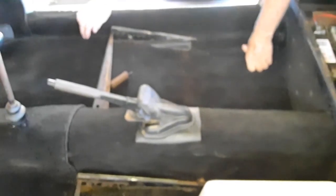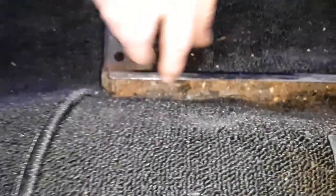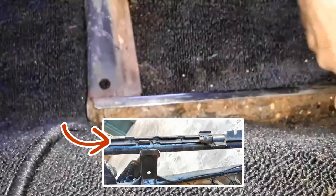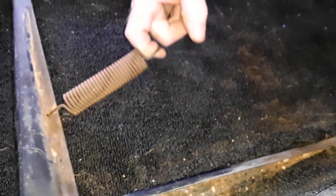We took the seats out and my beautiful bride did an excellent job of cleaning all the old crap off of these seat tracks. Kind of nice. She made a real good point of also getting the bottom sides. Most of the weight everything runs on the top, but it's nice because the seat tracks on the seats — they lip over and grab on both sides. The return spring was not hooked up, so that didn't help out.